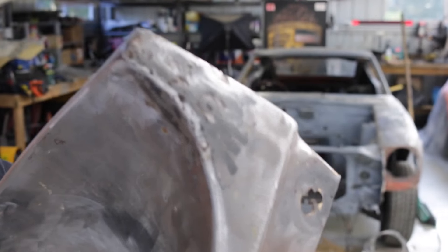As you might have guessed, I am saving my bonnet, and that means getting extremely dirty, messy, and dusty again and doing some more grinding. After some very, very dirty messy work, you can sort of see the level of damage in the front here. This has all been pushed in. I thought the damage would have traveled all the way along, but it's mostly the bit I uncovered that's more of a low. There's also a low all the way along this edge, and most of it's reasonably flat until the back here — this area is all a mangled mess and I'm going to have to repatch a whole area.